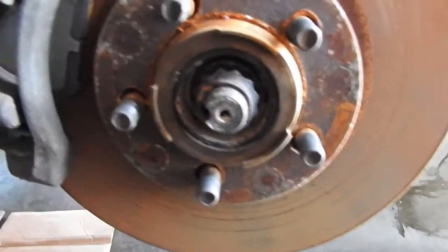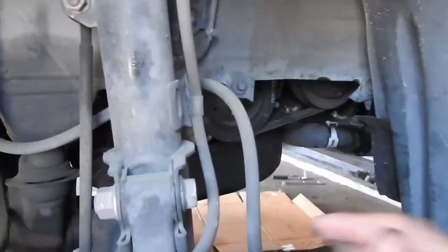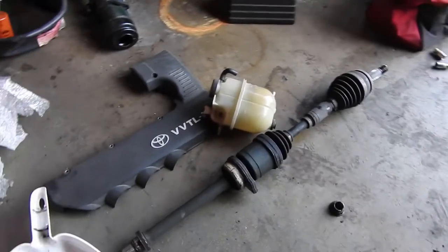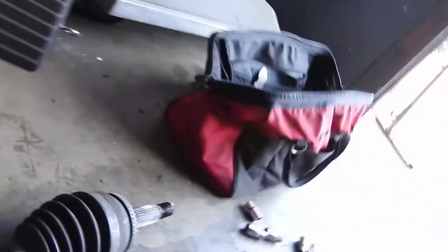We took off the wheels already, I'm gonna go through that. On these Toyotas, you better be careful because it has a punching, this one didn't have it. Basically, what I'm gonna remove is these two bolts, the tie rod right here, and your brake line, because this is gonna come forward and you're able to take off the axle. So, passenger side is off. It's pretty easy. Just gotta take off that one, and it has two bolts. Like I said in my last video, one here and one on the top.